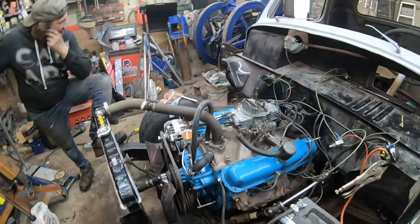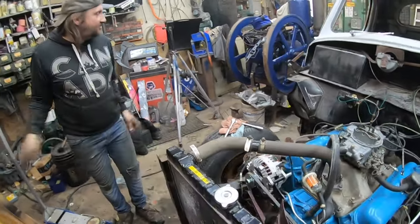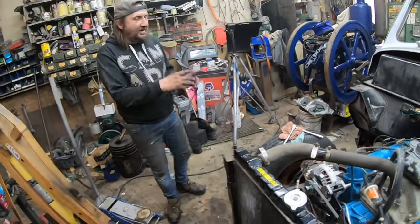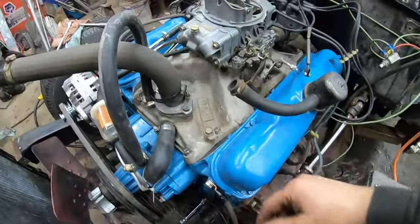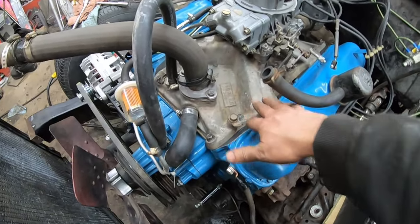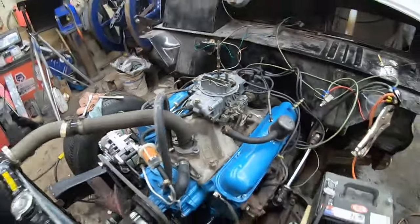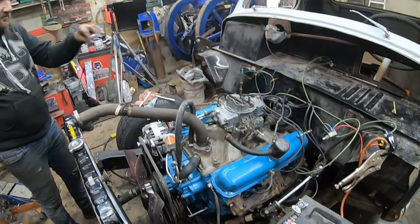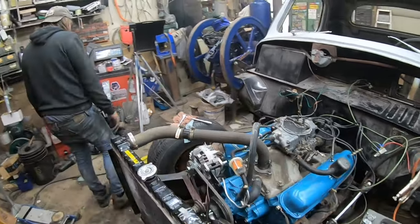So, I definitely win after fighting all weekend. There was nothing wrong with that intake. They just machined it too narrow. I think it's about 15 thou too narrow. After we bolted it up with a second set of head gaskets, we could put a 5 thou or 8 thou feeler gauge in the back, right where the oil and water passages go through. I think the biggest I found was 14 or 15 thou. But that thing can go in the garbage.